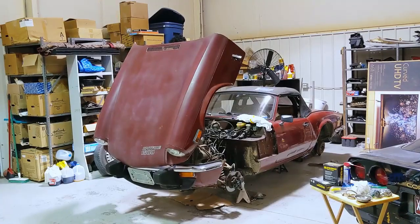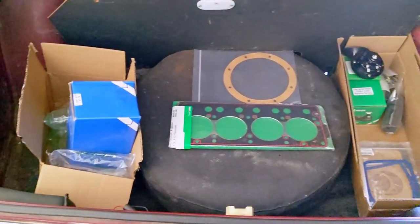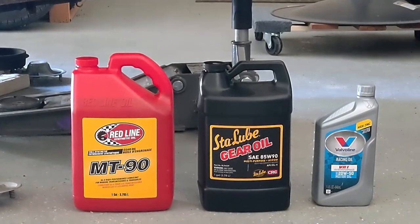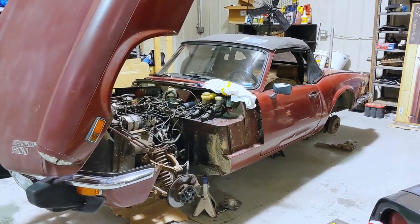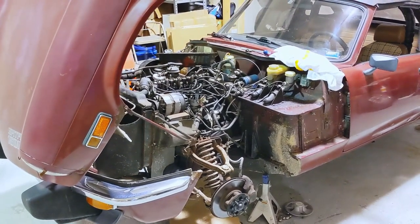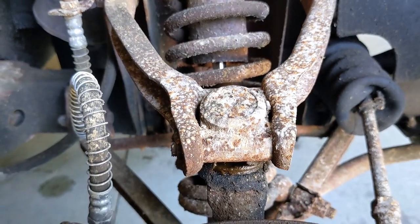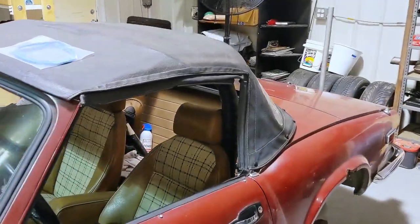To summarize: we're going to take it in stages. Stage one — the parts already in the trunk: brake master cylinder, ball joints, tie rods, valve cover gasket, and a couple other things. We'll change the oil, transmission fluid, and diff fluid, and keep an eye on leaks. If we need an oil pan gasket or head gasket down the road we can do that later. The next stage will fix that rust near the rear trailing arm, do the sway bar bushings and links, steering rack bushings or a whole new rack, shocks and springs, and maybe run new fuel lines.